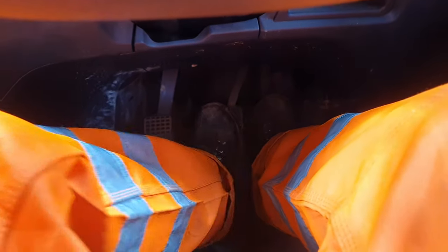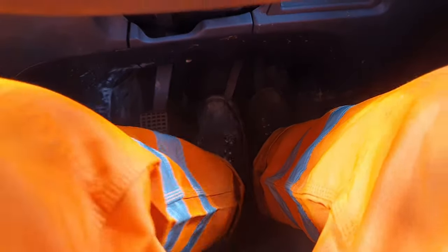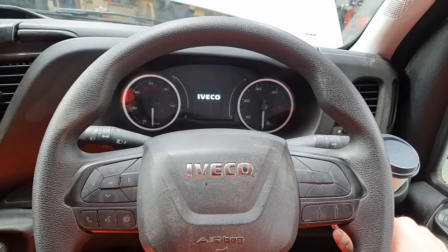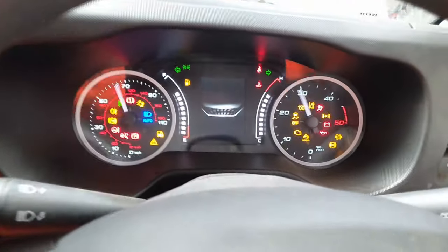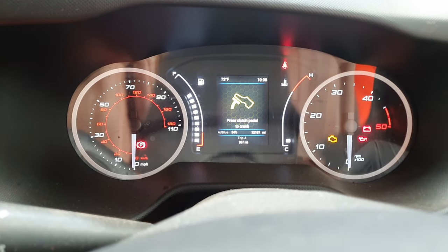Make sure you count this out — pump the brake pedal 10 times. There we go. Then release the throttle pedal. Now if we look at the dash you'll see the warning has gone off. I'm just going to key off the ignition, remove the keys, and re-key it back on, and you'll notice that the oil change warning has gone.